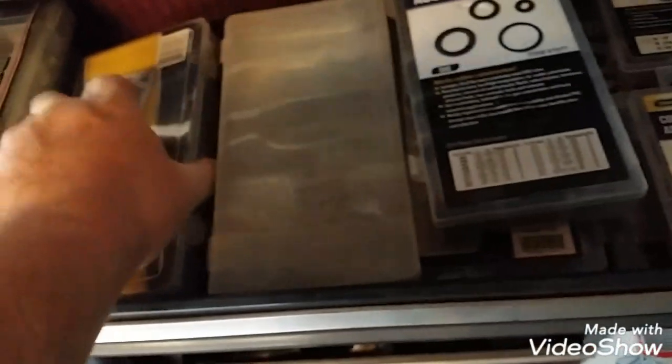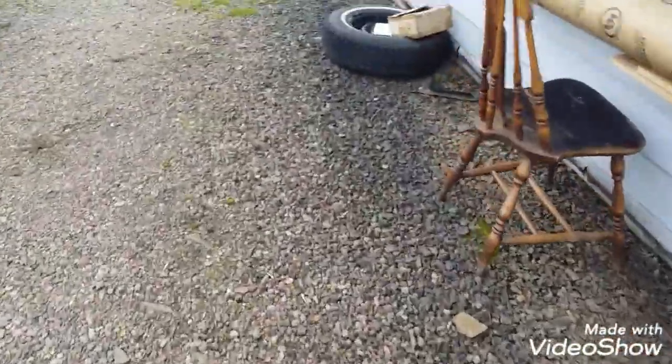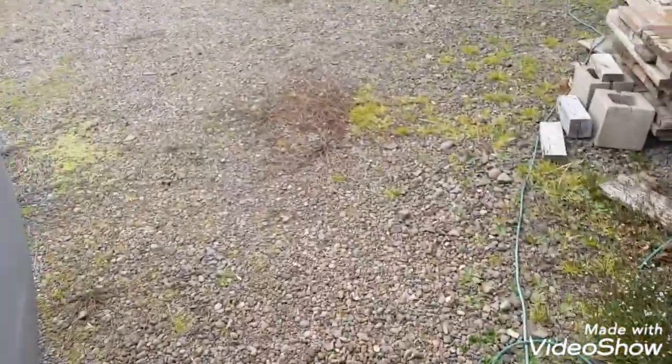So remember, the mower actually revved up both in the slow position and the choke position. This thing has some sort of an automatic choke. There's no linkage to it that I can see. I hope it works okay. But the spring that was selected for the governor was probably the only spring somebody had. And it's way too long. Let's see if we can do a little better. I'll show you what's on it.